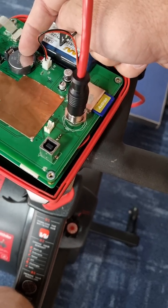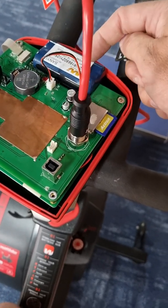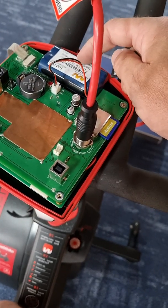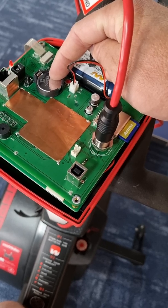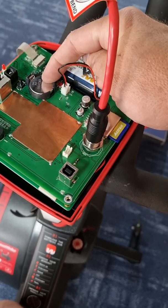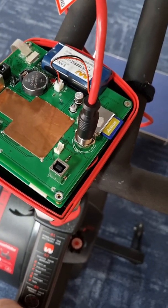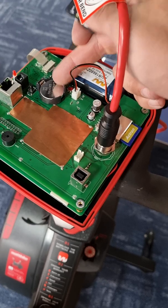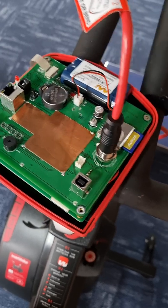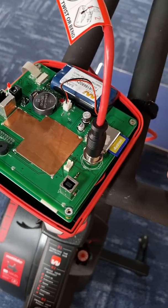Sometimes you might have enough charge in the main battery but not in the three-volt coin cell — you'll still need to replace that on its own. If the main battery is under 7.0–7.2 volts, replace it. If the three-volt battery reads 3.0, 2.8, or 2.7 volts, replace it. The brand new one I fitted is reading 3.31 volts, which tells me it has a full charge, and the main battery was reading about 7.8 volts.